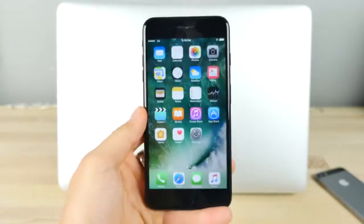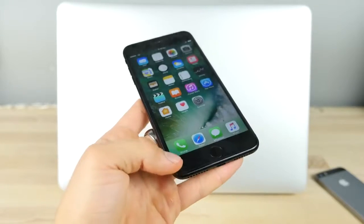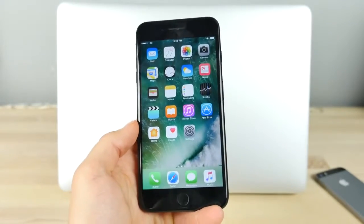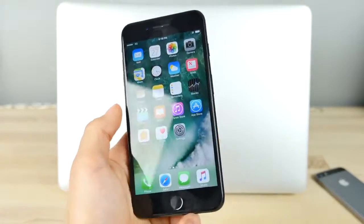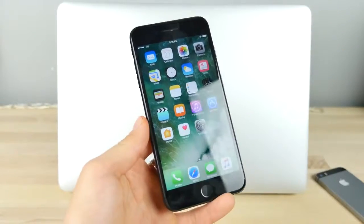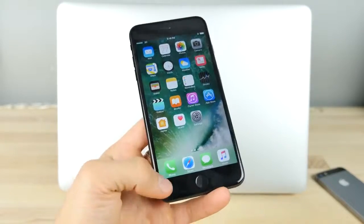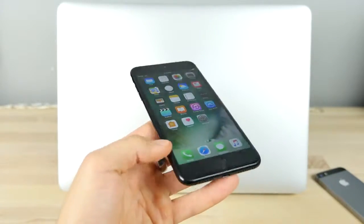2, waterproofing. That's going to be the big question on everybody's mind. We disassembled it. We tampered with the seal. Will it affect water resistance? And the answer is, it depends. Are you willing to buy a new seal? A new seal is only going to be a few dollars. So if you want to reapply a seal on the iPhone, you can absolutely keep the waterproofing if you damage the old one. The main point is, if you disassemble this thing, you can keep it water resistant if you do not alter the seal.